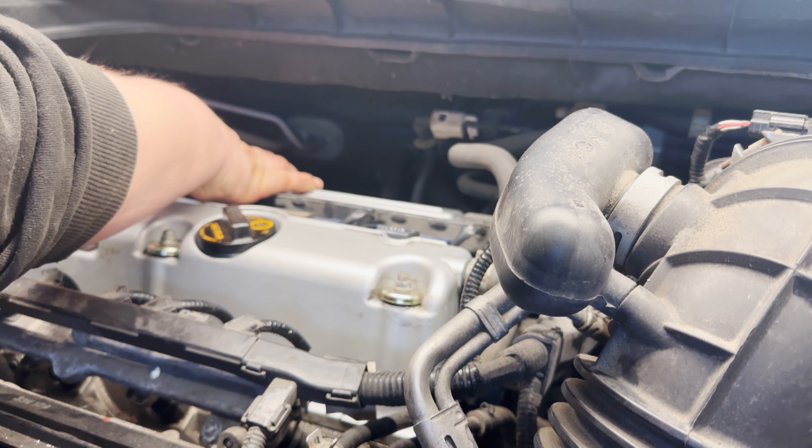Through my research, Honda uses Denso and NGK iridiums as factory plugs. Iridium plugs should be pre-gapped — you're not supposed to gap iridiums because the tip is so fine it could break. They usually come with a protector. Honda's gap spec is 39 to 42 thousandths of an inch.